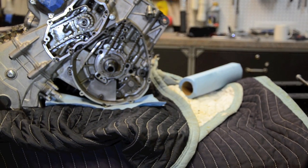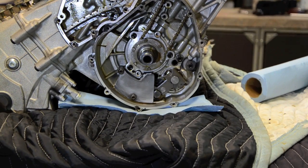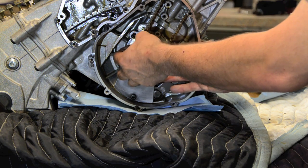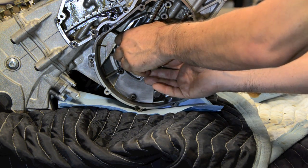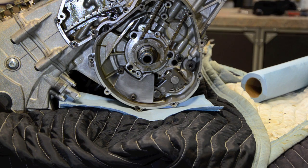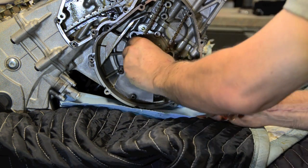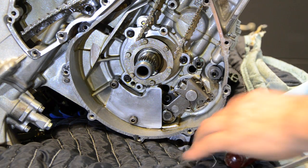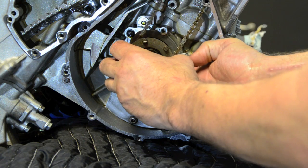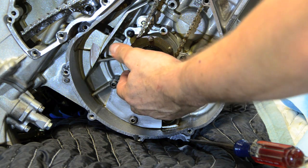Now I have to remove the sprocket — it basically just slides off the bearing. As I slide this out, I'm going to push the bearing back in. You have to press really hard and keep the bearing and the sleeve all the way at the back. Eventually you can pull this far enough that you get enough slack to let the chain go slack and get hold of it.